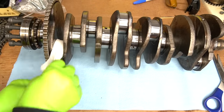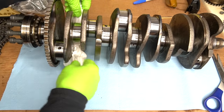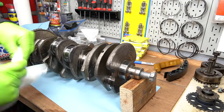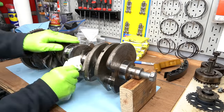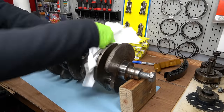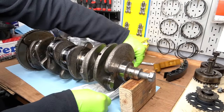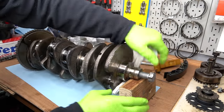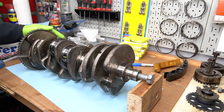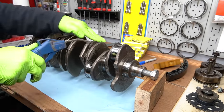Next we've got to get our crankshaft unwrapped and ready for oil clearance checking. The crankshaft was polished and cleaned at the machine shop, but we want to make sure it's perfectly clean. Using acetone and either the white lint-free cloth or those coffee filters, we're going to clean every little bit we can get to on the crankshaft, including the weights, both the main journals, and the connecting rod journals as well. Once it's as clean as possible, use compressed air to blow out any leftover fuzz.